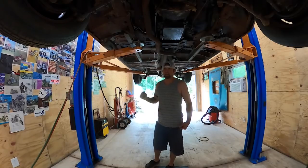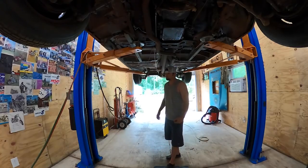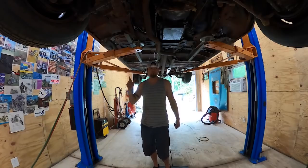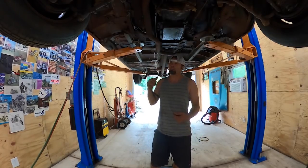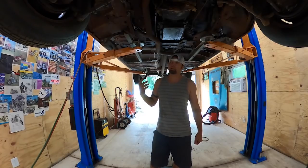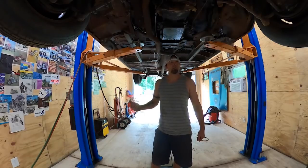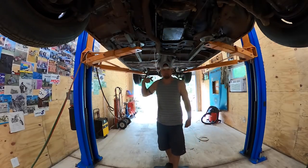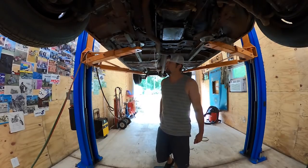So what do you do? You start cracking all the little connectors to see, okay, I must have a blockage or something. Of course, I start cracking connectors, no fluid, next connector, no fluid, and you know how these old brake lines work. Every time, if you're not careful, they just snap. So I snapped a brake line, so then I knew it was about game over already for that. So I followed it all the way back up to the master cylinder. It wasn't even pushing brake fluid out to the back brakes.